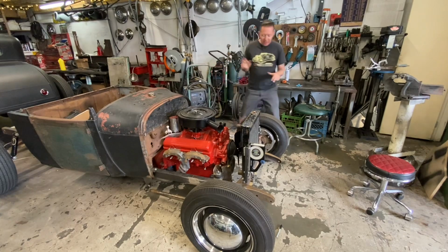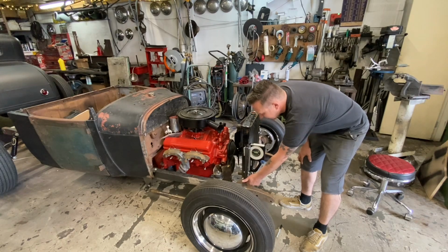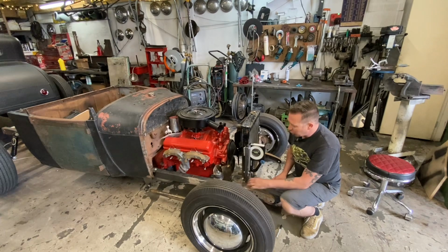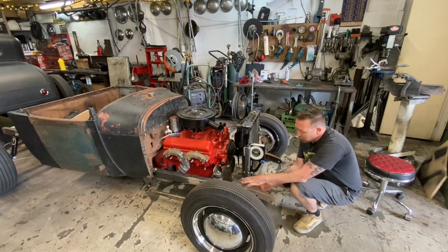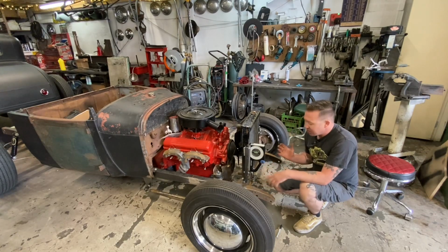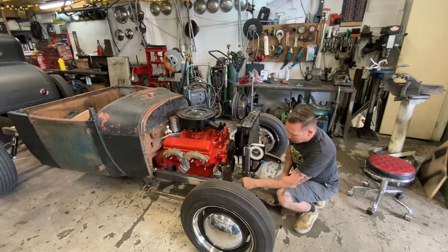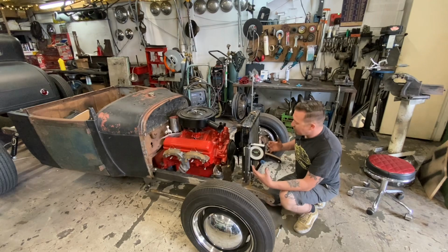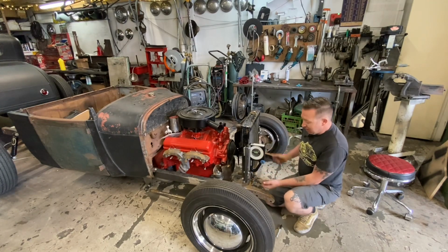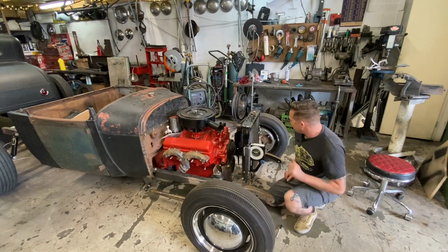it. That last clip you saw, these bolts are really tight up against there. I'm going to weld the bolts to this. Part of that reason, I don't know how many of you guys have ever actually had to put a nut and bolt together and get your fingers up through there, but to do that job by yourself is very hard. So, like when the car's all together, I'm going to weld the bolt to there, essentially making a stud so that in the future, when I go to take this rad on and off, I can just worry about the nut underneath and not have to worry about holding a wrench on there, because it's very awkward.